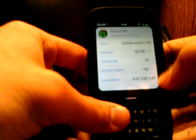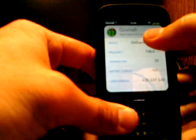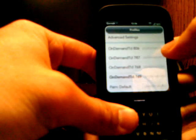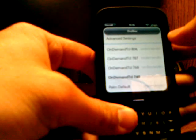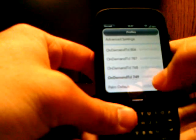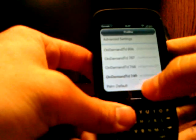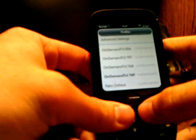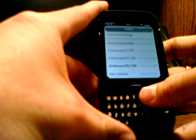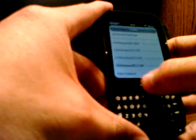You can see my Palm Pixie Plus is now running at 748.8 megahertz. Normally a Palm Pixie Plus runs at around 600 megahertz. To change the speed, go to the profile top menu, where you have a few options: 806 megahertz, 787, 768, and 749 megahertz. I chose 749 because I didn't want to put too much strain on my battery — that's something to consider when overclocking — and you also don't want to overheat your phone.